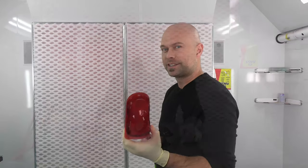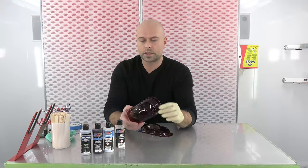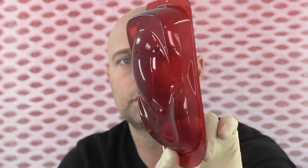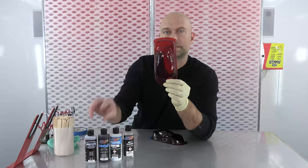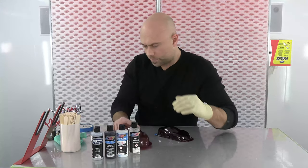We're in the last portion of application — which is typically the first step but for reverse painting it's the last step. The car is totally dry and you can see a really transparent, even color that looks like tint. It still has the backing film on it which will distort the final view. We're going to put the 6013 silver sealer over the back — it has a lot of metallic flake in it which will really push that red to be nice and vibrant.